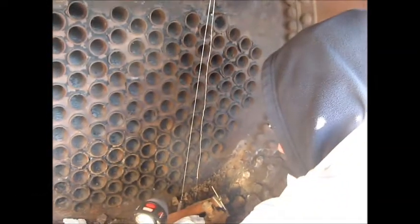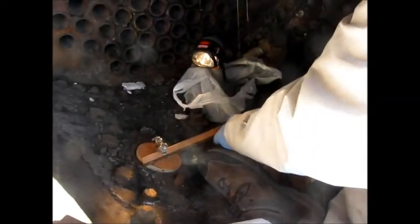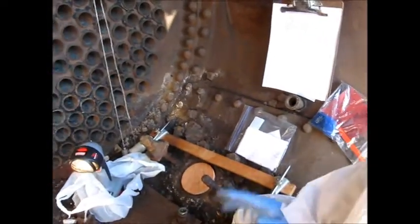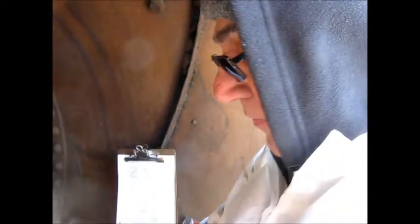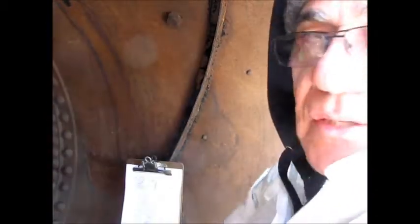What I'm doing here, Josh, is trying to use these blanks that I put in there so I can see what the center lines are. I have to lay this out in a standard rule because I don't have a print yet. If I can get a print, then I can verify it. But I want to get the dimensions so that when I do get this, start to lay out the casting, I know where the casting's supposed to be.